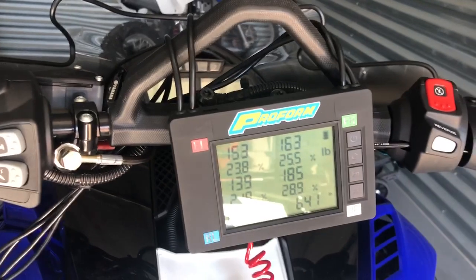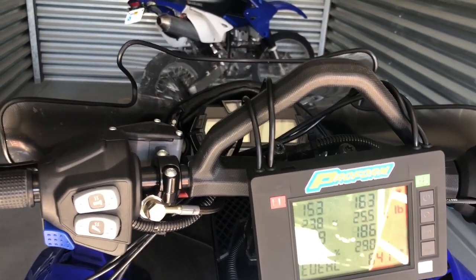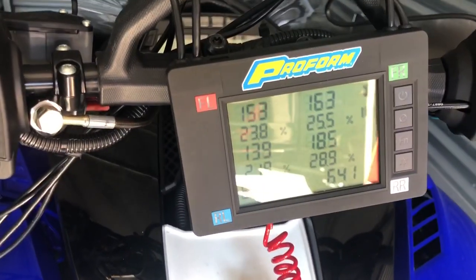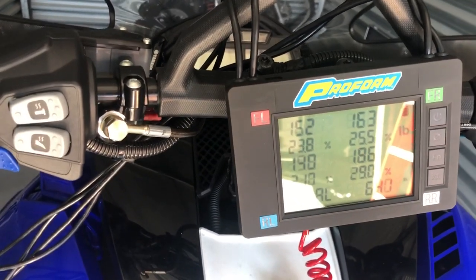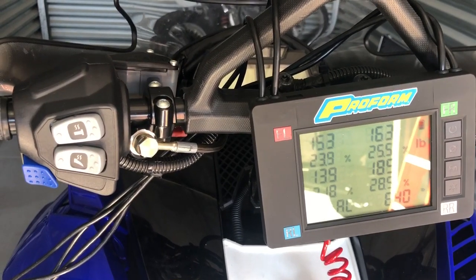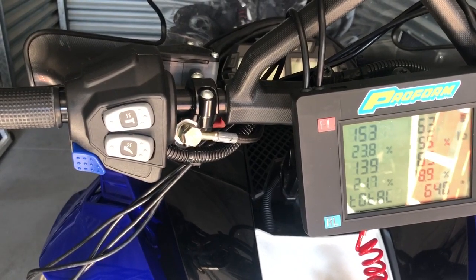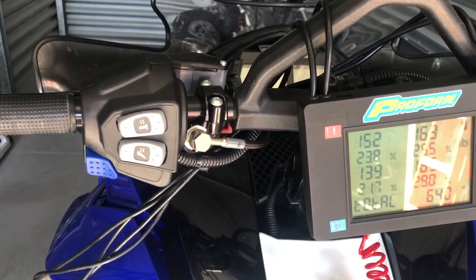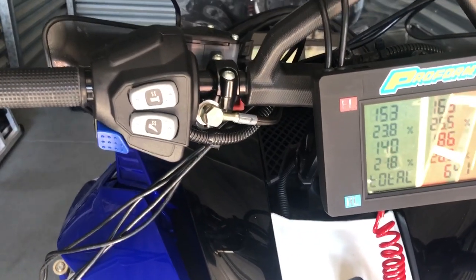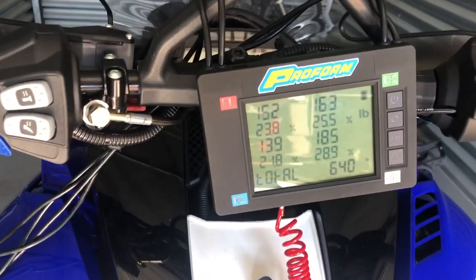I also noticed that somebody discussed that stock Yamaha has the springs tightened all the way down. I assume on both sides. It wasn't clear from the person who posted, but given that the weight distribution of the sled itself is a right side bias, the springs would need to be recalibrated to get basically a 50-50 bias. In this case, we try to set it around 21.5 for each side, or get as close as we can to that.